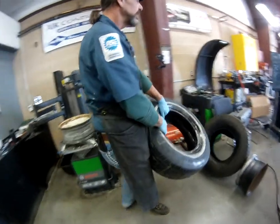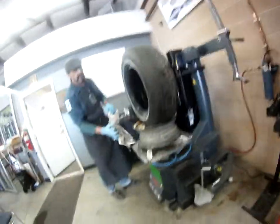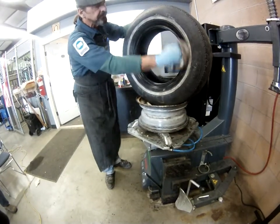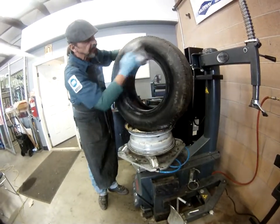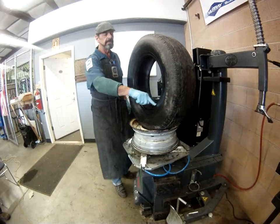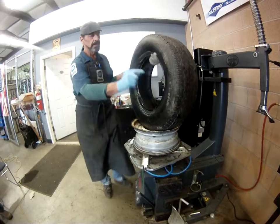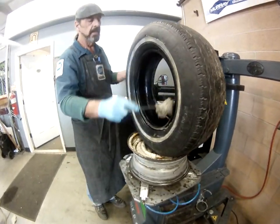Now I'm going to remount the tire. To remount it, I'm going to go ahead and lubricate the tire. During the lubrication process, clean the rim — always make sure that the rims are dry and clean, because this will cause the rim to rust if you don't keep it cleaned off. I like to get all the dirt off the sidewall and start over fresh with new tire soap. Now I'm going to lubricate the bead and the bead face right here. All I've got to do is lubricate the bead and the bead face. Let the machine do all the work for you. Turn the tire around, lubricate the bead and the bead face.